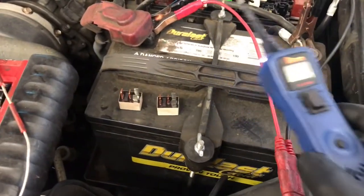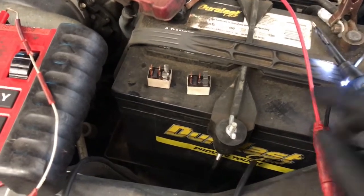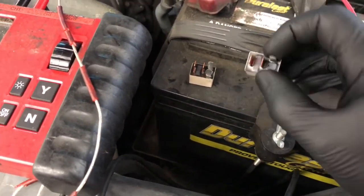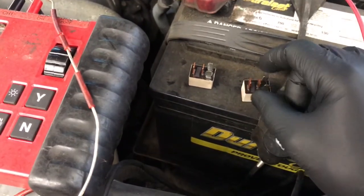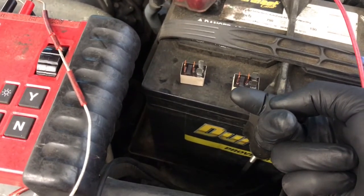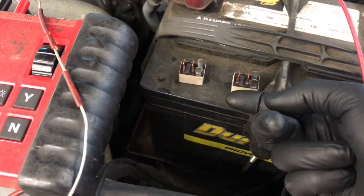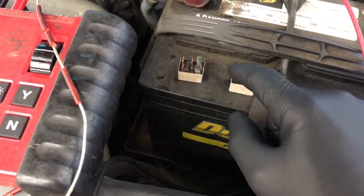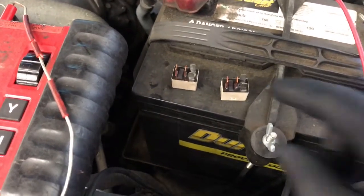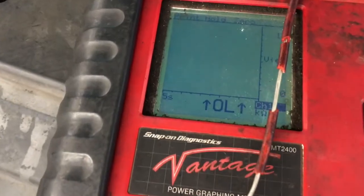The way I tested it was I used my power probe here, hooked up to the positive and negative on the battery terminal. I'm going to apply power and ground to the low amp circuit here and complete the circuit — that's supposed to close a little magnetic door switch inside the relay, and that completes the circuit to the high amp side of it. I got my test leads hooked up to an ohm meter on my digital ohm meter here.